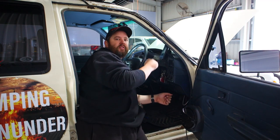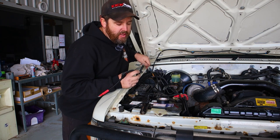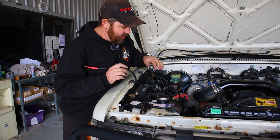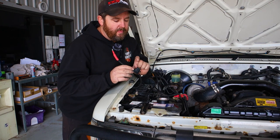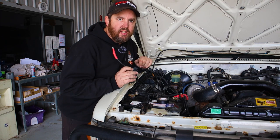Pull the excess 4mm twin core through the firewall and we'll fuse at the front. I've just run this wiring back to the firewall. The negative I'm going to go off the battery — you can either go off the battery or a body earth. And the positive, I'm using a 25-amp fuse; otherwise you can use a 30-amp circuit breaker. And that's it — then we'll test it.